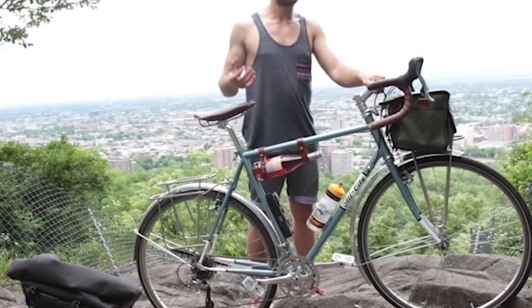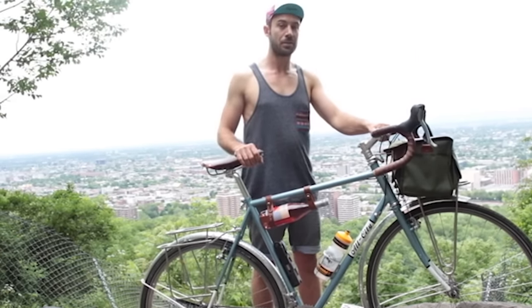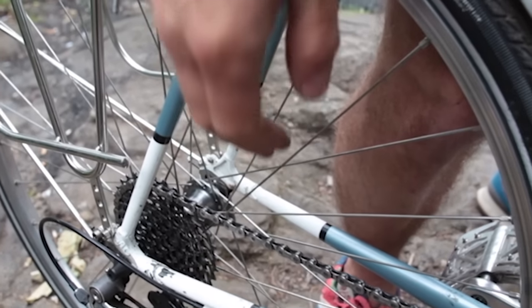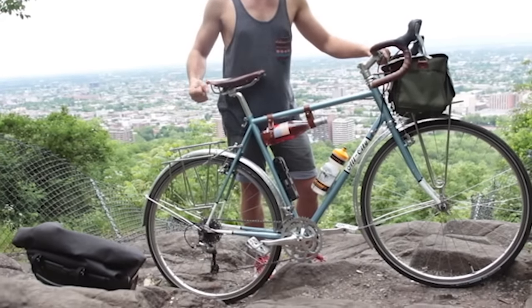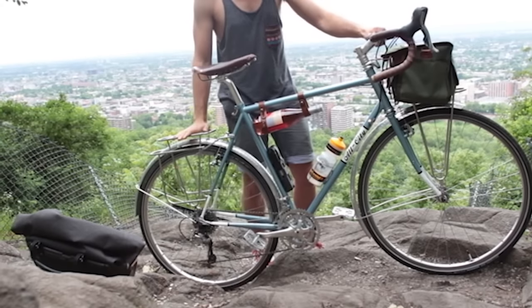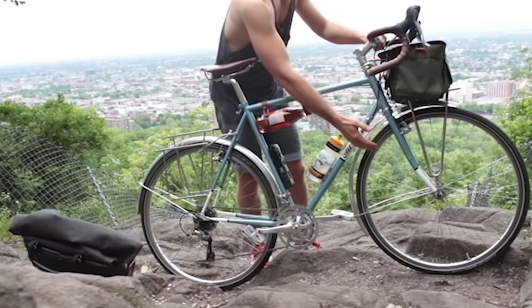The other thing that's really important when touring, because of all of the weight on the bike, is to have really solid wheels. A standard wheel has 32 spokes. Often in touring bikes you're going to go with a 36-spoke wheel — it's just a little bit more durable, especially in the rear, because generally people will load panniers heavier in the rear. So you have a 36-spoke rear, sometimes the same with the front.